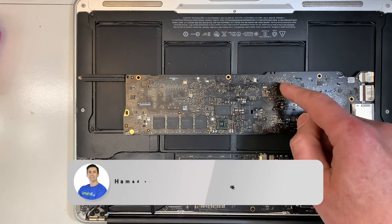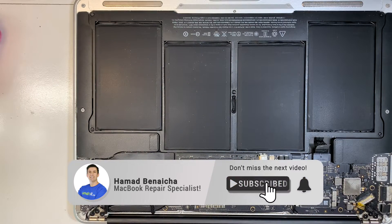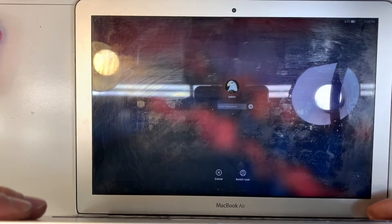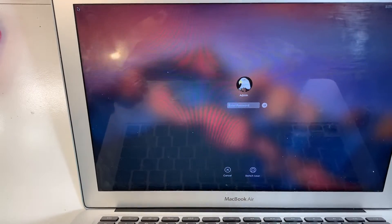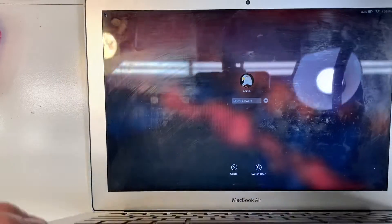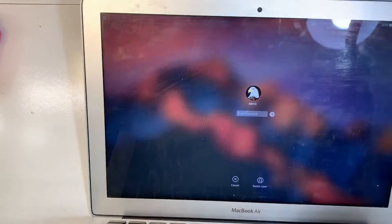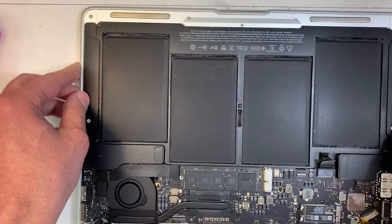The surrounding components over here. In this case, luckily enough for me, when I turn it on I noticed that the trackpad — let's see over here — it doesn't move. And also the plastic key doesn't work either. The cable doesn't work either. So that's an indication that it's probably the sensors or the cable on the trackpad.